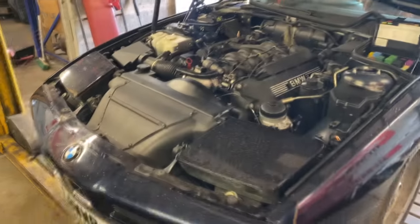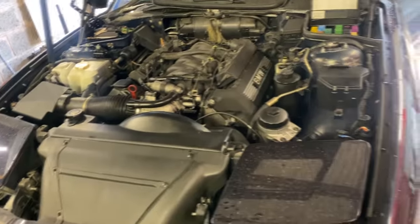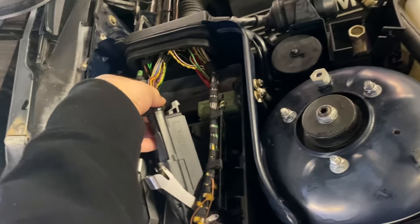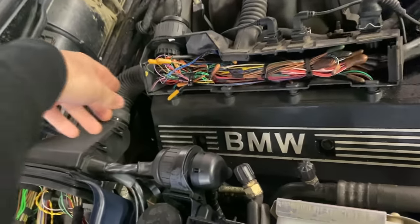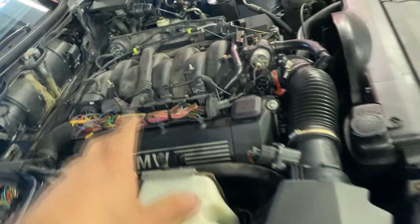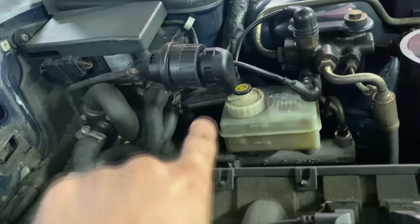The swap is done. Let's go through exactly what's been done so you have an idea of what's going on from start to finish. First of all, this plug was for the gearbox ECU — that's been removed. I took most of the wiring off. There was some stuff but it's not powered up, so I just left it. No excess wiring down there. That pipe over here — that's the pipe for your master cylinder. You've got a hole there and it's connected to the main brake fluid reservoir, so the pipe goes from there at the back towards the front.